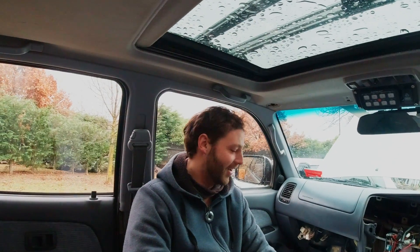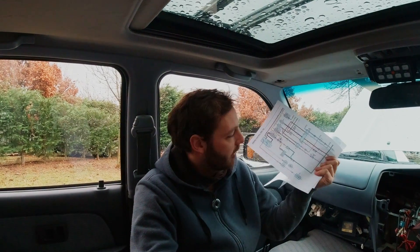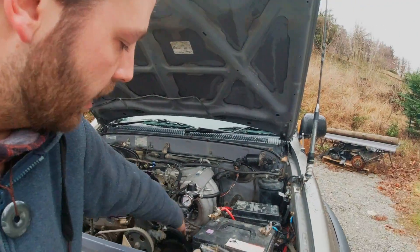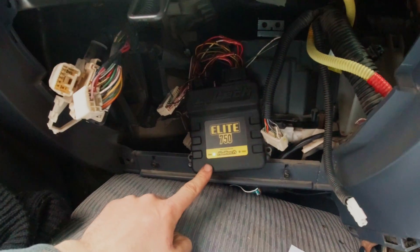Welcome back. I've got a huge smile on my face because I've been mucking around for the last 20 minutes trying to find out why this thing wouldn't have power after I did all the bits. Been double-checking everything, and to be honest only some of the references here line up with the references on my other sheets — there's been a lot of differences in colors and so on. But after a while I found the issue. There is a ground down here, all the way down here. It was originally meant to be mounted up there, but I removed it and grounded it down there. It had three wires on it, so it's probably all three grounds going into the ECU. Which now means that when we turn the key, our ECU has power. So that's step one done.